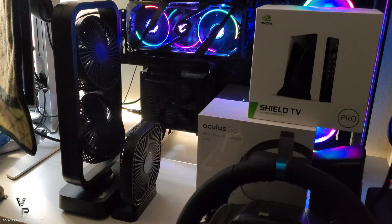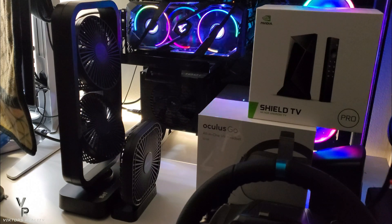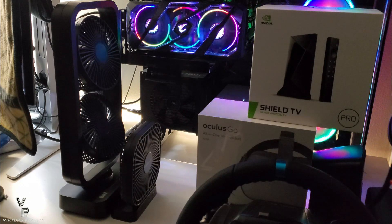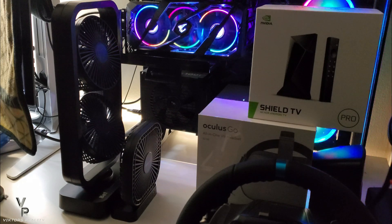This is what I use for my setup. As you can see, it's a Thermaltake P3 tempered glass case. I have a lot of room for air and I can put this behind the GPU pushing more air in. I have it three inches from the glass. I found that with my Aorus GPU at one inch from the glass, you can't do anything with it — it gets super hot, 80°C easy. At two inches, that's where all my benchmarks are, and I get around 60°C with the most demanding things. I'm now trying three inches from the glass with the fan pushing a lot of air to the GPU and out.